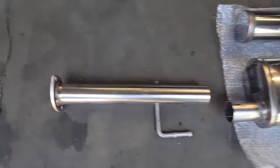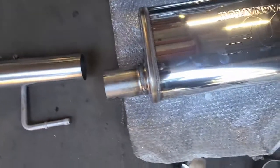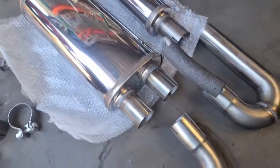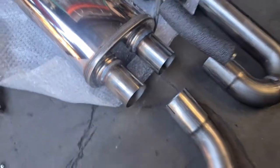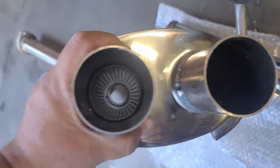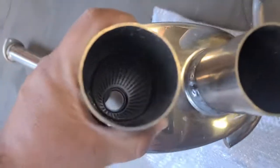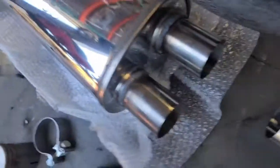Now, taking a closer look at the exhaust system, you'll see we have the very same factory flange with the recess for the gasket, and the same hanger. There's our inlet pipe to our new Overland Series muffler, and the dual outlet, which makes it unique. It is a straight-through design, so that's where we pick up the power and build more power, and this side is where we control the sound. There's a port here, a little more visible from the other side, and that port allows the sound waves to travel out this end through our U-pipe and then into our Helmholtz chamber.